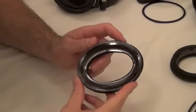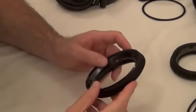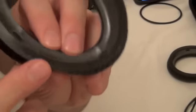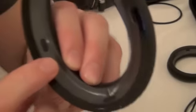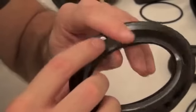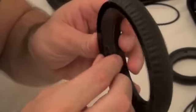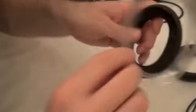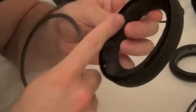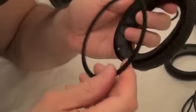This can be tricky so I'm going to show you the easiest way to do it. In here you'll see a plastic rim right there — you have the rim connected to the ear pad on the outside, then you have the thinner plastic on the inside. Now this thinner plastic on the inside can be removed. We're going to take that out just like that and put it to the side. It's much easier to install the lock ring without that piece of plastic there.